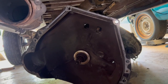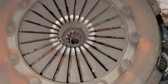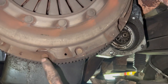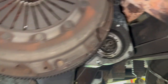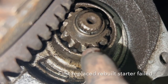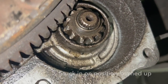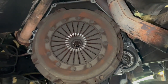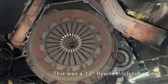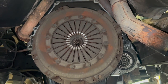It's basically just sitting now under my vehicle, out of the way — it didn't come crashing down or anything. It's going to be a challenge to get that sucker back up in there. What happens next is I've got to pull the pressure plate off. Looking at the starter — that's just fried, so my starter's going to have to be replaced. That's because of going up against these broken teeth so long. Once I get this off, I can measure it and figure out how to order the right heavy duty clutch. This was a South Bend heavy duty clutch and it was a booger to push in — I like that a lot about this truck.